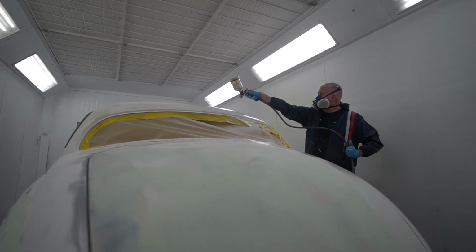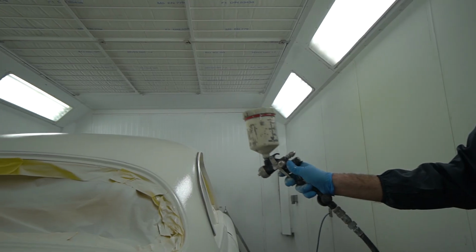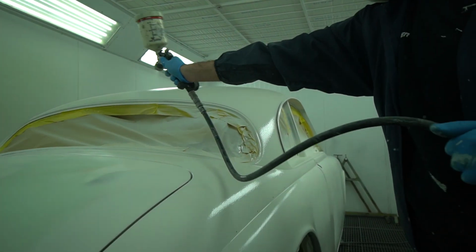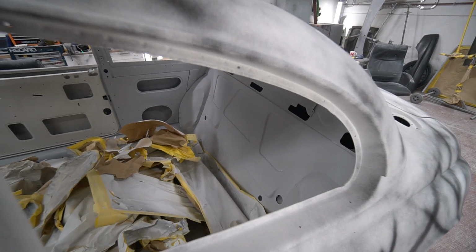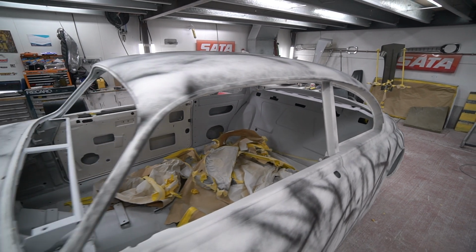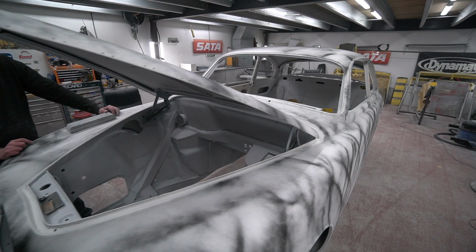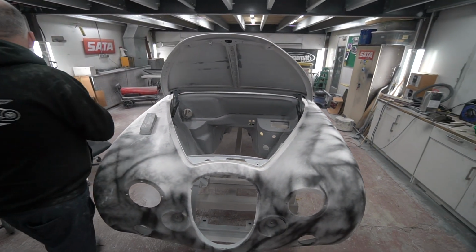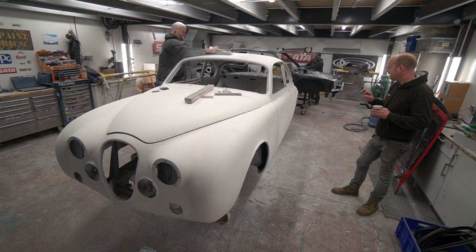So that's had another coat of that over the whole lot to try and pick up any areas where we've got quite a few areas where we were all the way through any build that we had. And the shape was pretty much there or thereabouts. So another coat of that enables everything to be blocked without any high and low spots from where we're getting thin areas of coating. Minimises the high and lows that inevitably occur where you break through the build, where you break through the polyester. So now there should be hopefully very few areas where we actually go all the way through the polyester. So I think we're on the later stages.